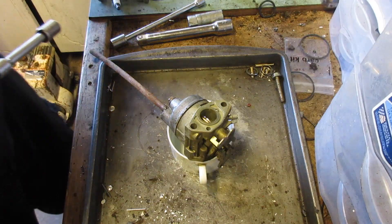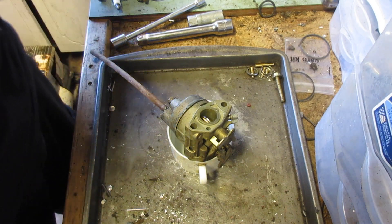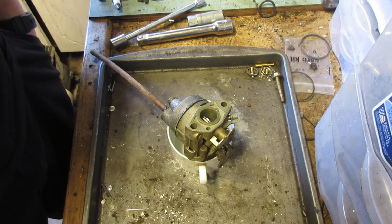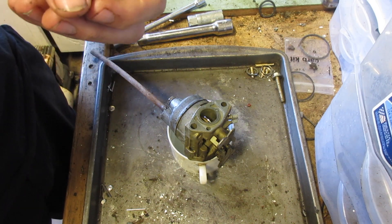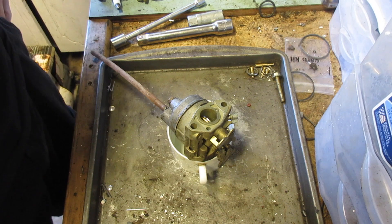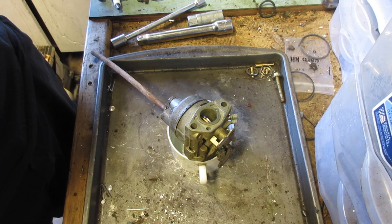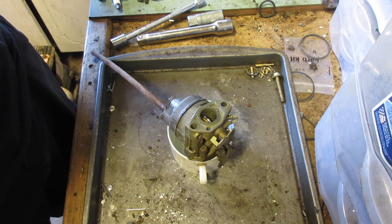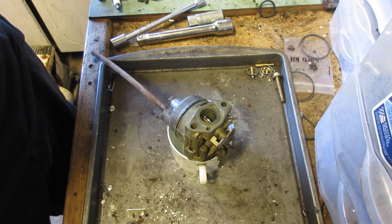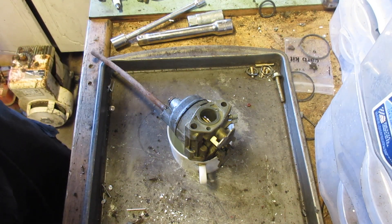I'm going to take all that nonsense off. I'm kind of running into fuel drain — going to get a little dirt in there, but it was a clean cup. So I'm thinking we're going to find two things: one, water settles on the bottom. Water's surface tension won't allow it to go through such a small opening, so you'll never get rid of the water going through the jet — you're just going to starve the jet. That's one reason this can happen. So when pulling the choke on you have a little more suction and you're able to pull a little bit of fuel up — just enough for it to run. Or the jets are clogged to the point where it needs extra suction to get any fuel. We're going to see if there's water or just gunk — I'm leaning towards gunk.